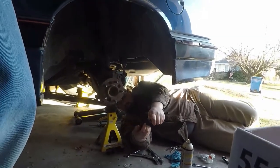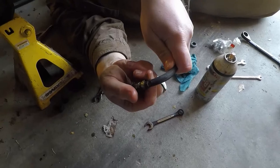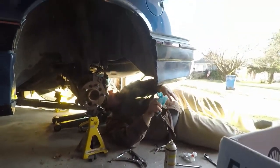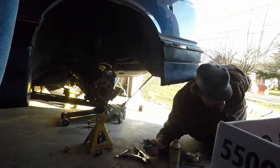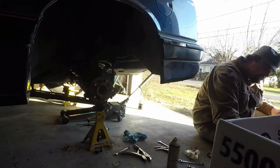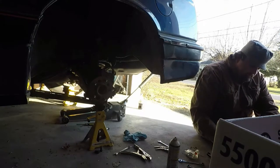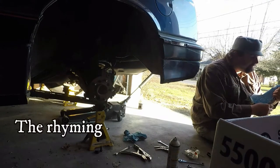And there's the break in it. Where it's not broken, it's not leaking, but it's not holding shape, so it's collapsing and trapping fluid. And locked the brake up, and then it got overheated, and that fried the cylinder fully deployed. So, that was interesting. If you remember a previous video, fluid is what pushes on the brake pads and makes it go stoppy-stoppy. And let me stop leaning against that so the car does not collapse.